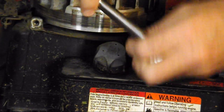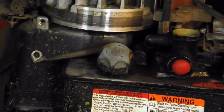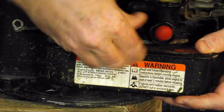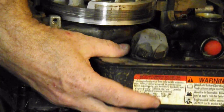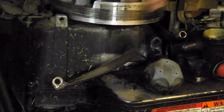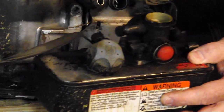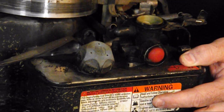This bolt here is a 1/2 inch bolt. There's a little hose right here and another hose right here, and it comes apart just like that. For our linkage, you might want to take a photograph of the linkage up here. The gas tank and the carburetor will come off in one piece. I'm going to pour this fuel into an old gas can that I use for old gas, which I'll use maybe to clean parts off later.